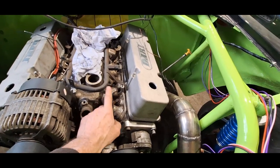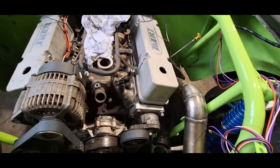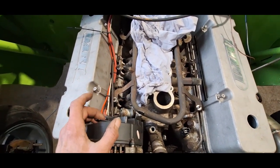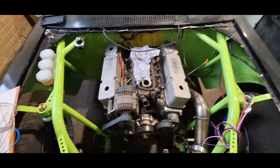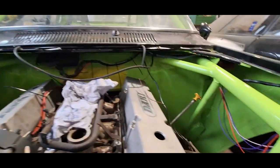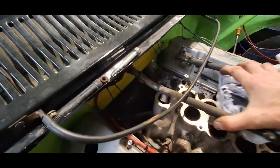This sensor will be necessary — that's the water temperature sensor for the ECU. This one here will be plugged; that is the temperature sensor for the gauge, which I'm not using. I'm using a capillary gauge, as you can see by the pipes down there. I've wired up the power wires to the alternator, the alternator exciter wire, and the live feed to the fuse box. So the fuse box is live and when you turn it on, the car actually turns over. I've done that first just for routing of cables — it's all just tie-wrapped loosely together under there. I've taped off the bulkhead there for mounting of the ignition coils.